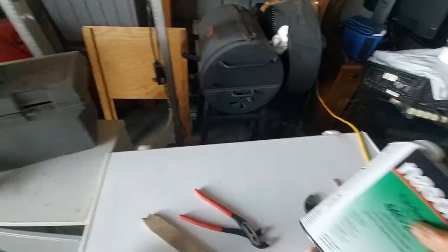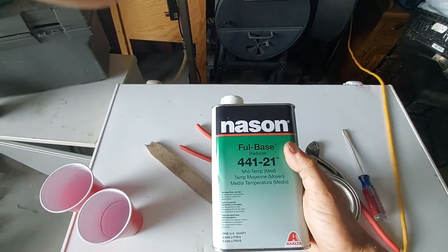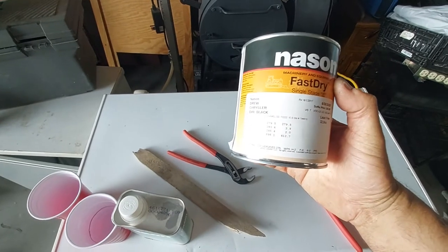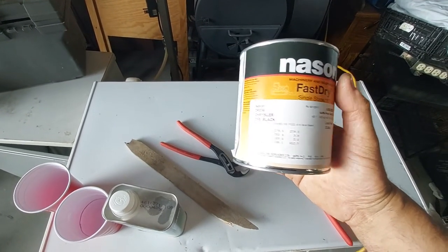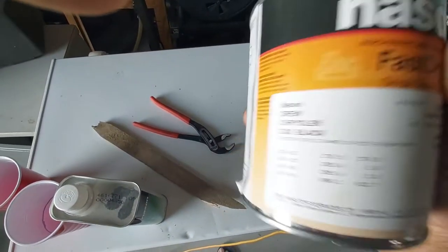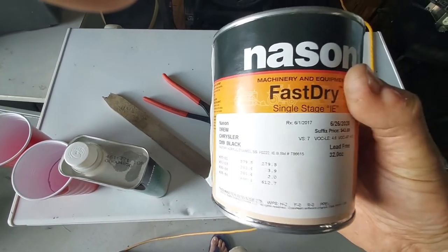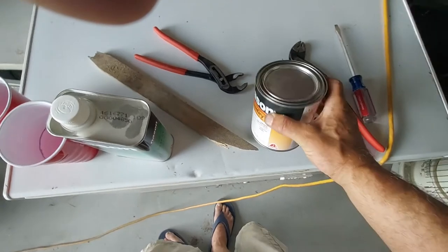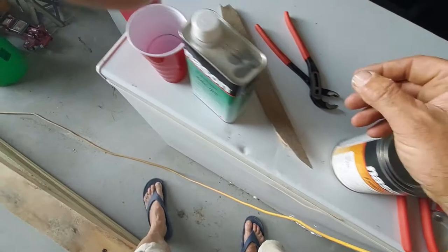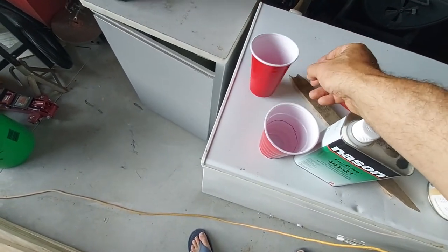I don't know much about painting, I've never done it. But I've got a base thinner, a reducer. I need one part of reducer to four parts of this acrylic enamel. This is what was on my drive shaft when I took that out and got it balanced — they actually put this on it. I thought it was so nice, I figured I'd pick something up and knew I'd use it at some point. So I'm going to measure out one part of the base and four parts of the paint, get her in there and mix her up.